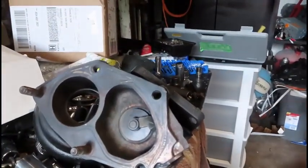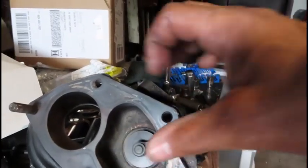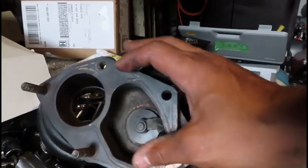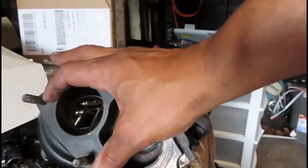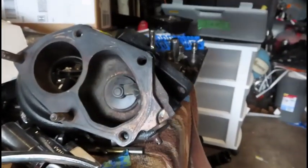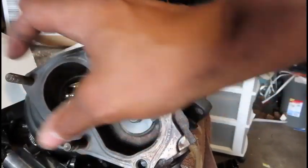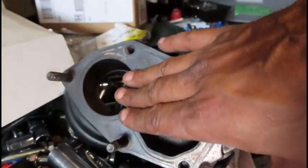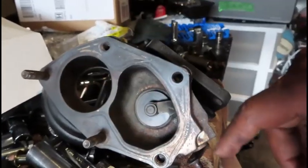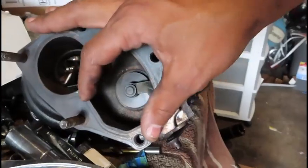Currently, the way it's set up is that this door opens, there's a pipe that dumps into this pipe that goes along here, and it all basically collects and then goes out of the exhaust. Well, what happens is this creates more back pressure, especially when you have the wheel right here. It's going to push a little bit back towards the wheel, not a whole lot, but enough. So basically what the dump is going to do is separate the two pipes.